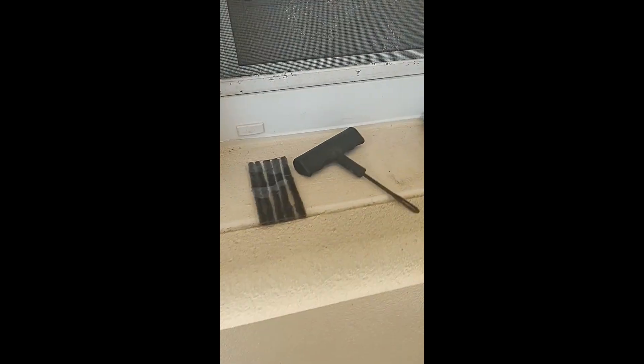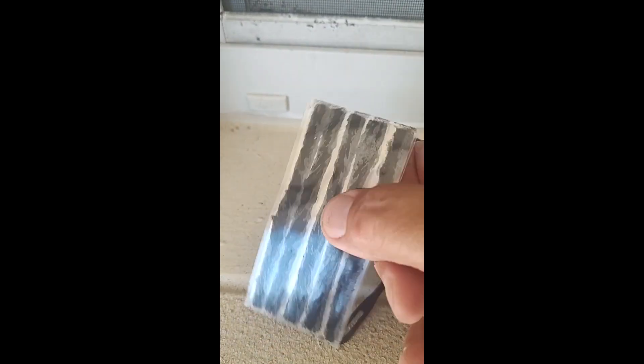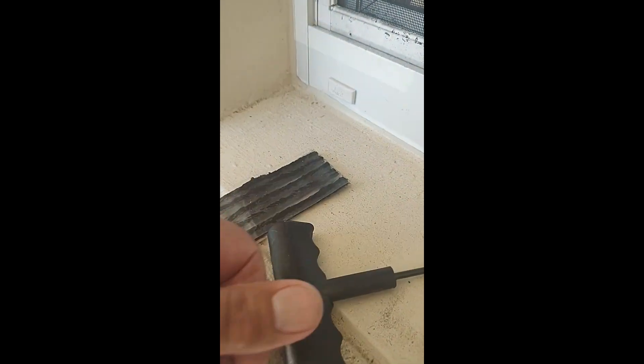I'm going to use a little kit that I bought years ago — it's a tire plug kit. It comes with these little fabric pre-glued strips. You pull out the nail, stick the strip in here, and shove it in. I'm going to try to do this one-handed. A lot of other kits come with a little serrated tool to rough up the tire, but I don't have that tool and I don't think I'm going to need it. I'll use some snips to pull this sucker out.